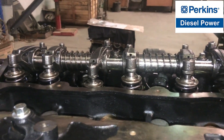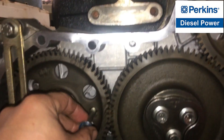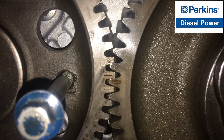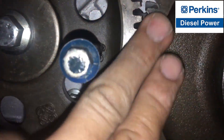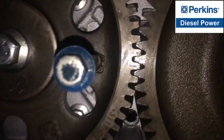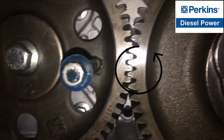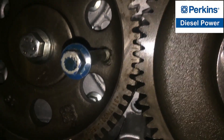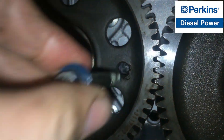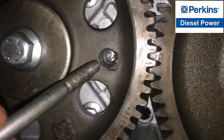If we are going to see the accurate timings right here on the timing gears, we can see that the timing mark of the crankshaft and the timing mark of the idler must be specifically aligned. So this timing hole is to be considered as the timing mark.